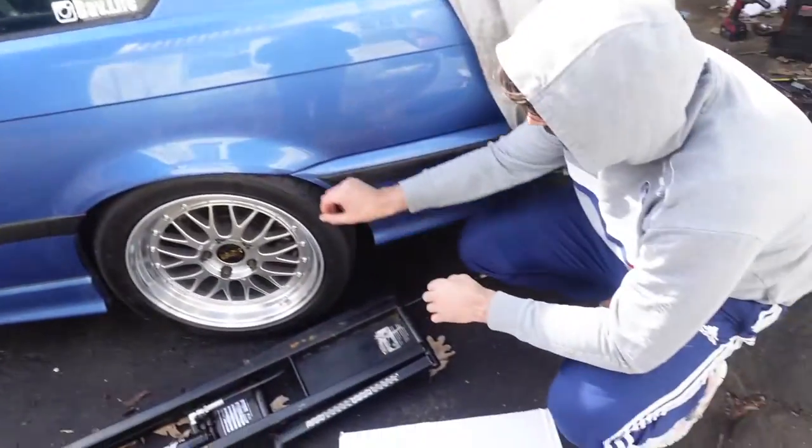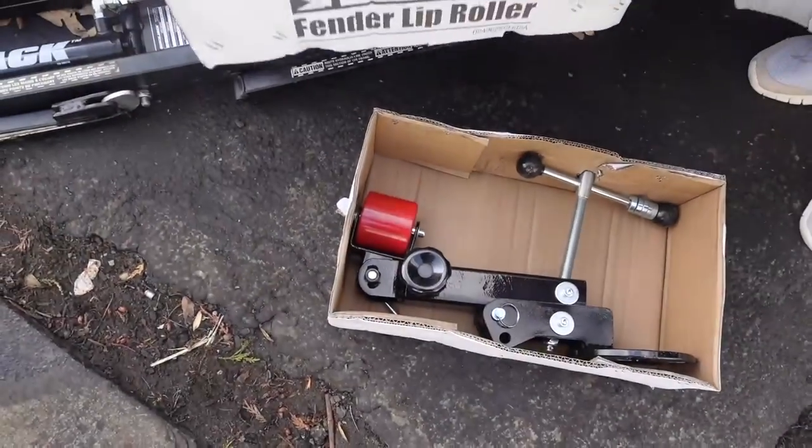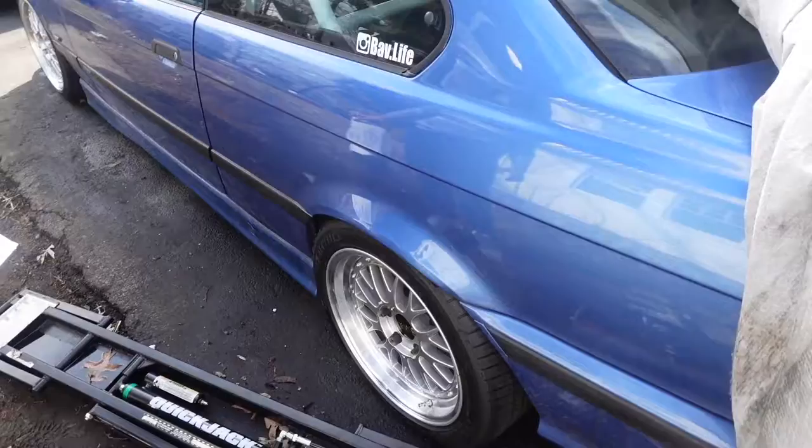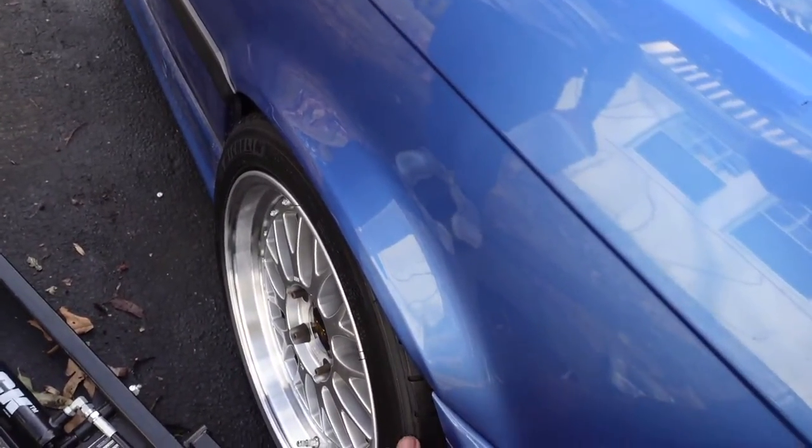We're gonna be rolling and pulling Esco's rear quarter panel, like the rear fenders, rear arches, because this wheel is actually rubbing really badly. So we decided to pull the trigger on a Schwaben roller kit from ECS Tuning and their heat gun that comes with the kit. It's also gonna help us remove this so it's not scraping and cutting up his tire and destroying his car.